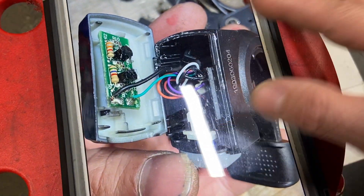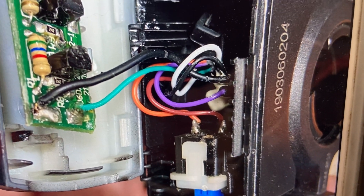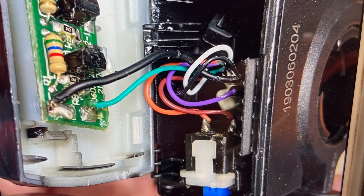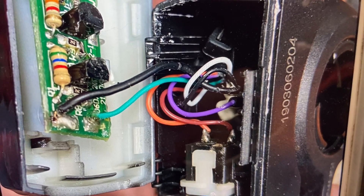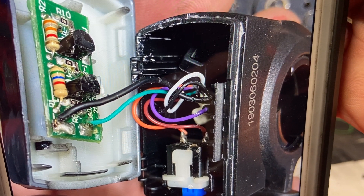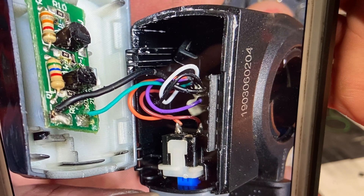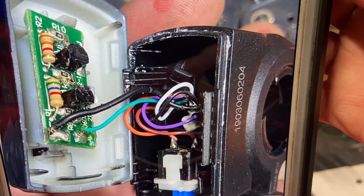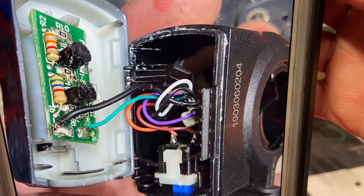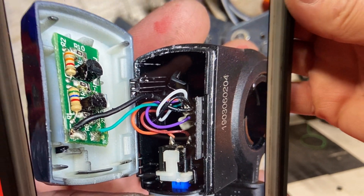I got a picture here and it shows you the colors. So if you notice, there's a red, brown, purple, white, black, and green. Now the brown one goes to the hardwire, to the battery. The red and the green one you can actually tie them together — that goes to the switch. The throttle: purple goes to red on the throttle. White is the signal wire. And black is always ground. As long as you get the ground and the 5-volt plus proper, you'll be fine. Just never touch the red and the black — ever, on any wires — because you'll do damage.